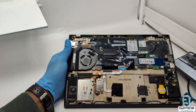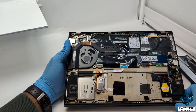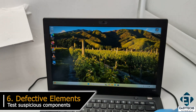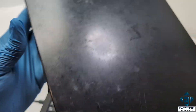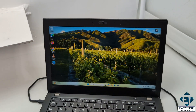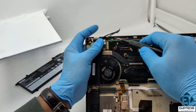For this X280, the RAM is embedded so I won't be able to perform a RAM swap on it. So, with all regular troubleshooting steps yielding no further positive results, I had to think a bit outside the box. While trying to shut down the laptop on one occasion, I observed that the long press on the power button didn't lead to an instant shutdown as would normally be the case with all laptops. That got me suspicious of the power button — I was wondering if there could be an issue with the power button that prevents the long press shutdown function. Luckily, I have another scrap X280 meant for parts, so it was easy to source another power button from it. The power button happens to be a separate chip attached to the motherboard by a cable, so I was able to change it on the functional X280.